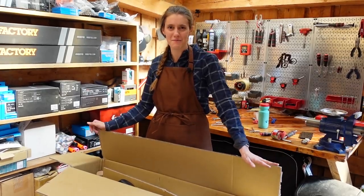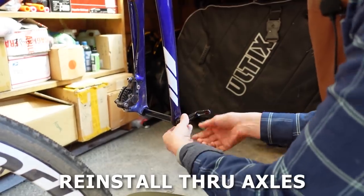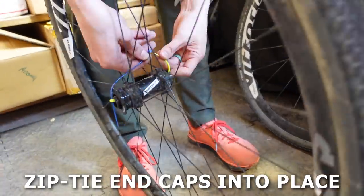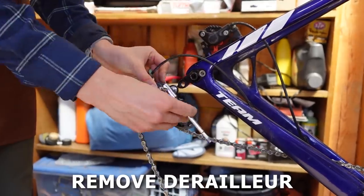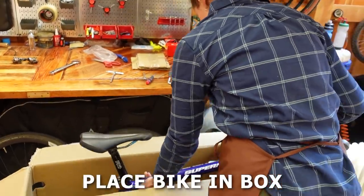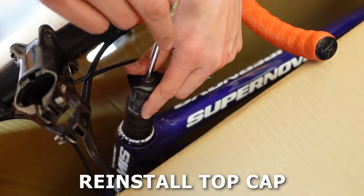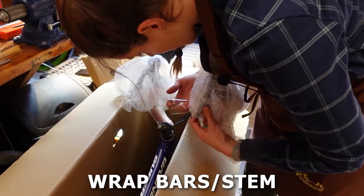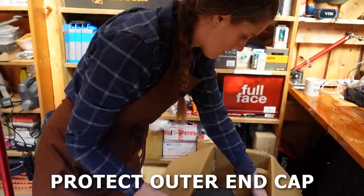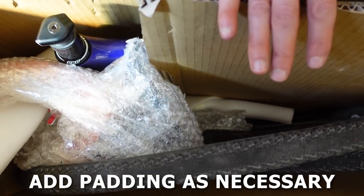Here's how to pack a bike into a cardboard box in one minute. Start by removing the pedals from your bike. Next, remove the wheels and insert the brake shims. Make sure to reinstall the through axles in your fork and rear triangle so they don't get lost. Now remove the rotors from the wheels, reattach the lock rings or rotor bolts, and create a rotor protector with cardboard and tape. If your wheels have removable end caps, run a zip tie through the hubs to keep them attached. Now remove the derailleur and carefully wrap it in protective material. Wrap your chain as well to keep it from scratching the chainstay. Place foam or cardboard on the bottom of the chainring, then place the bike in the box. Lower or remove the seat post, then remove the stem and handlebars. If you have spacers above and below the stem, take a photo so you remember which ones go where. Reinstall the top cap and tighten the stem bolts so they don't fall out during transit. Wrap the bars and stem in bubble wrap and carefully slide them into the box, making sure any spots that touch the frame are protected. Place a piece of cardboard next to the frame, then carefully insert the wheels, making sure to protect the outer end cap of the outside wheel to keep it from punching a hole through the box. Now double check that every contact point between the box, wheels, frame, and handlebars is well padded — and don't forget your rotors.